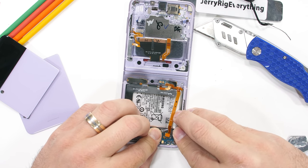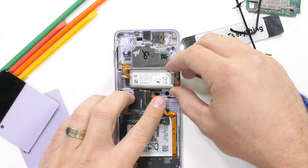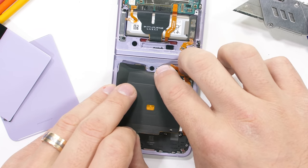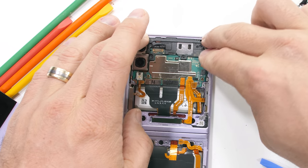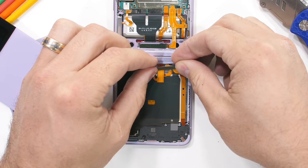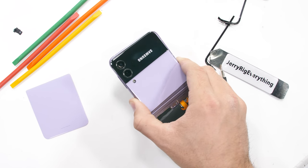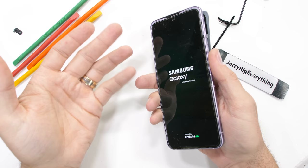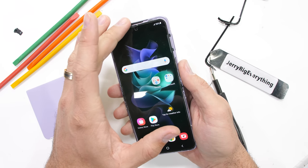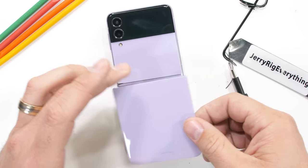With the battery back in place, along with the charge port and bottom loudspeaker, we move up to the top battery. I'll slide the motherboard back into its slot and plug in the extension ribbons. The final plastics are in place along with the sneaky SIM card tray, and last but not least, the metal brackets that keep all the connectors connected. I'll plug in the rear display, press the power button... and would you look at that — success! Both screens are still functioning and the phone is powered on. Basically pretty much just like new. I'm very surprised it's still functioning.